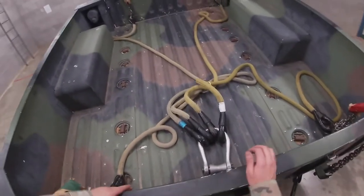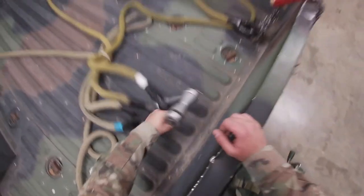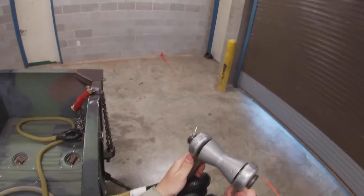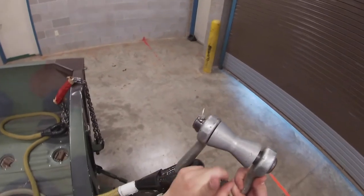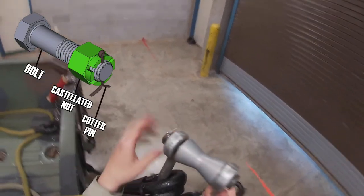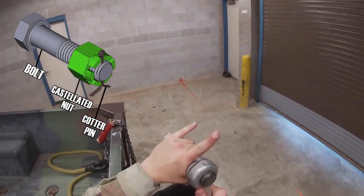Moving back to the front — tape on all lights. You can either get in the trailer or grab your apex if it's close enough. You're going to make what's called the phase 2 gang sign right here on that spacer after you've checked it. Check your spacer and your bolt, your castellated nut, and your cotter pin.